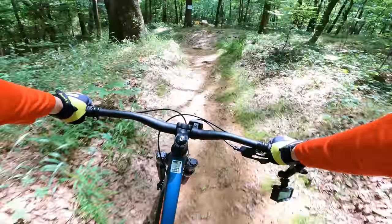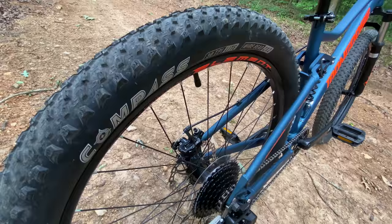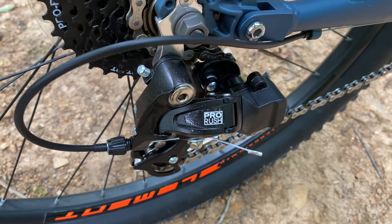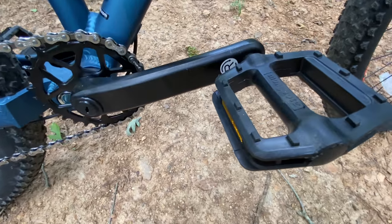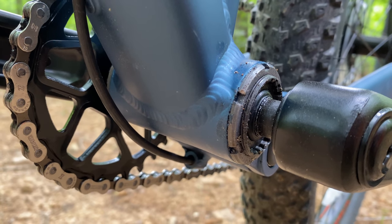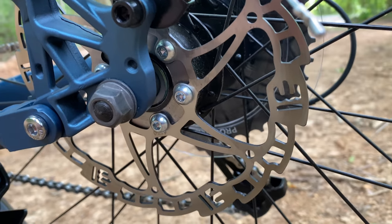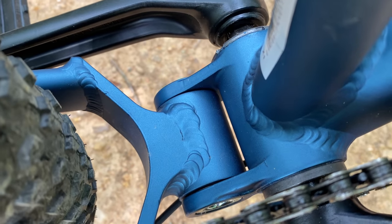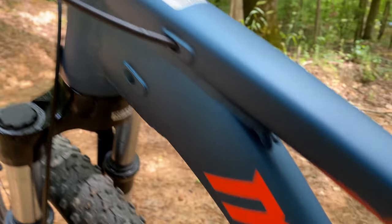This fits right in with the rare gems — the XR Pro and the Hydroform. A good first impression with this bike. Notable observations on my first ride: I like that the Mongoose team gave us the features we want, the carryovers from the Schwinn bikes. Adding beefy wheels and a full suspension definitely ups the ante. I was curious how the ProRush clutch would work with a moving rear frame — just fine, on par with its usual performance. I'll be publishing full official specs once the Mongoose team gets them to me. A lot of people have asked about the bottom bracket — it's 68mm on both the Ardor and this Ledge X1. I'm also happy to report I'm two for two with these generic disc brakes on the new Mongoose bikes — they work just fine out of the box. Pivots: so far, not a peep or a complaint. This is a similar design to the XR Pro, and we'll be digging into the work soon to see what's hiding underneath in these critical areas.